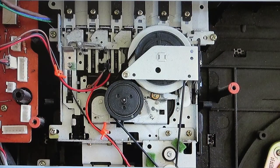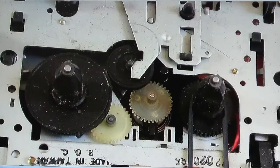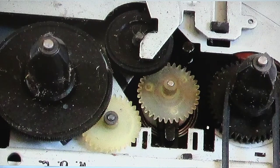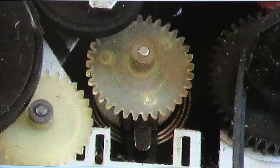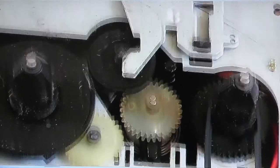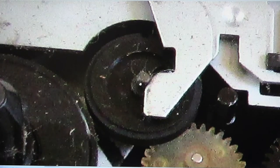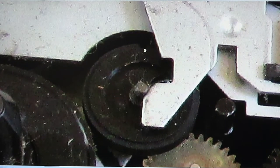This is a jack shaft right here — this drives the front side stuff. That drives, I believe, this gear here, and then this gear is an idler. The whole issue with this radio is this tire, which you can barely see — I didn't rotate it for this picture — but right there it's broken. There's not even any tire right there, there's nothing there. It's just dead space, rubber, dead space and rubber again.